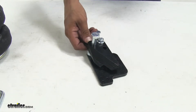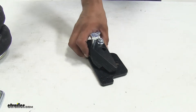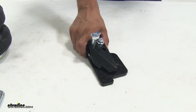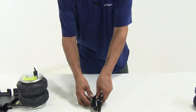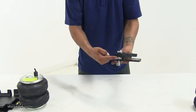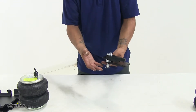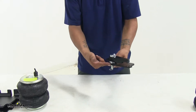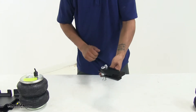Our overload pads are designed to work with airbags as well, and what they're going to do is take the need for putting so much air in your airbags out of the equation. Since you're going to get some support from the overload pads themselves, you won't need to put in so much air in your airbags — because sometimes when you have too much air in your airbags it causes too much stress to be taken off your suspension and then it doesn't work the way it was designed. Our overload pads are also adjustable — we're going to have several different spacer washers or shims that we need to find out how much we need for our application, since each spring may be a little bit different. We can adjust how much space there is to engage and disengage our overload pads.